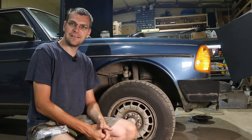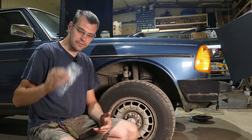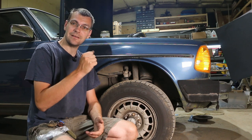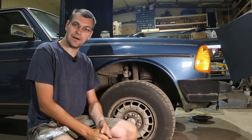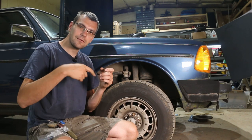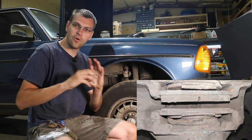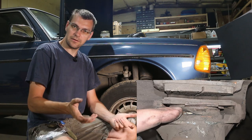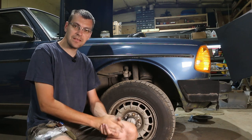What was originally intended as a quick video on how to replace your brake pads and wear sensors on a W123 has spiraled out of control — now I'm replacing calipers, rotors, brake lines, and flushing all the fluid out. I got the other side apart and found that the seal around the caliper piston was completely destroyed, ripped and torn to shreds, and the caliper was sticking. It wore one pad out completely while the other one was still brand new. The braking system components on this car are nearly 40 years old, so it was time to do this.